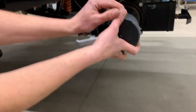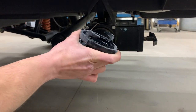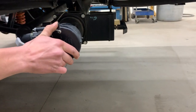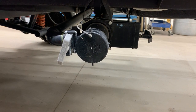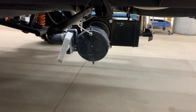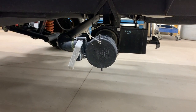Right here you do have your sewer outlet. You just give that a twist and it's going to unlock. You've got two ears — the same two ears are going to be on your sewer hose and they just connect up like so. You got your black tank and your gray tank. Your black tank's your dirtiest water, so you're going to want to empty that first because that's filled from your toilets. Then you got your gray tank, which is filled from your sinks and showers, and you can come behind the black tank with that — just rinsing out that hose, trying to keep that less odor.